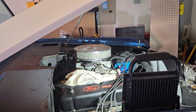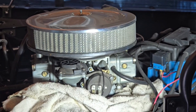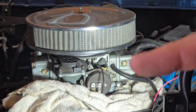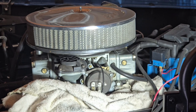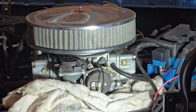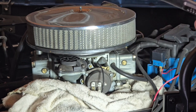Let me get a little light on the action. As you can see here, we have our Holley carb. Right here is one of your float screws, and then there's your other float screw. Two things you'll need: a flat head screwdriver — preferably a larger one — and then you also want to have a 5/8 wrench, or a 16mm can also work.